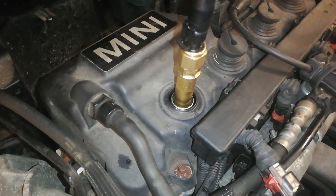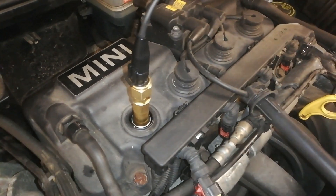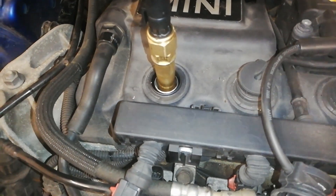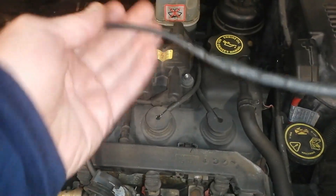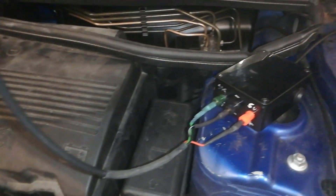That is a spark plug extension that you can buy for an ordinary compression test or an ordinary gauge, with our 250 PSI absolute sensor in it. We have the signal wire up out of the road because we have HT leads there - you don't want that line over the top of the HT leads or you'll maybe get a bit of noise or interference. That's our little 5 volt box, homemade, run off a 9 volt battery inside it.